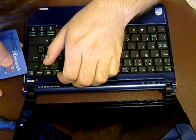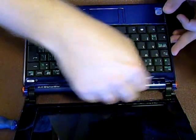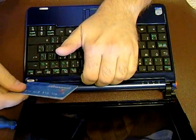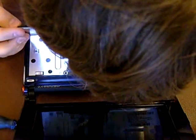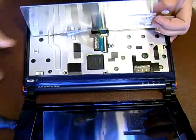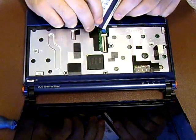Slip it under the keys very carefully and pull up. It looks like there's actually some clips on the side too — there's two on the side, one by the caps lock key and one by the enter key. Once you've done that, carefully lift your keyboard up. There's a little black connector here — put the credit card underneath, flip it up, and remove the keyboard. Place the keyboard in a safe place. Also, there's another connector here for the touchpad — you might as well take that off too.